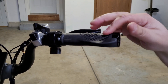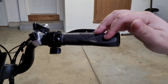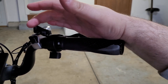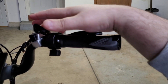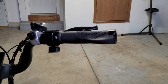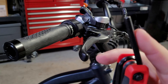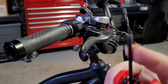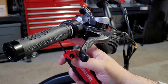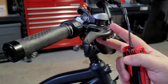Our grip is tightened so this definitely will not twist on me anymore. It'll stay put and provide the best level of support on my palm without shifting. Now I'll move everything as close to the grip as possible, make sure everything is nice, tight, and secure. For the brake lever, you're going to need a slightly bigger allen wrench than what you've been using for the thumb throttle. I'm going to sit on the bike to see where the best placement is, but I'll go ahead and tighten up the brake lever because I kind of already know where I want that.